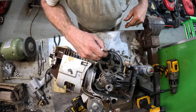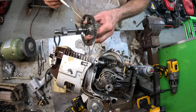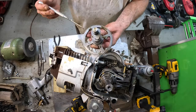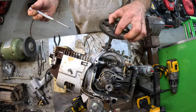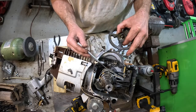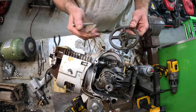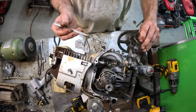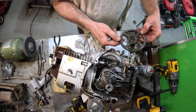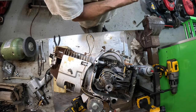Make sure the lifters are pushed in all the way, and we'll just pop it up. See that piece rod right there, and it's gone. See where it was? Gone. And there is the timing mark, and there's the corresponding timing mark. I did one a while back, and it was completely 180 degrees out because it had another mark on her somewhere, and somebody got confused. Easy mistake to make. If you do it all the time, you know what to look for, really.